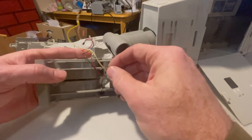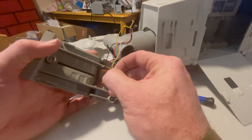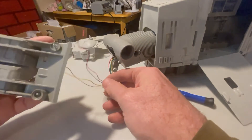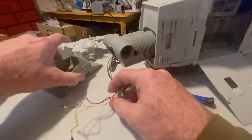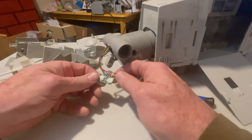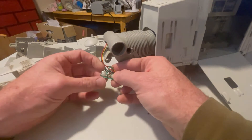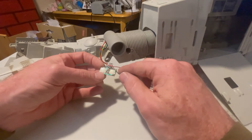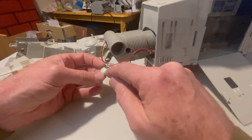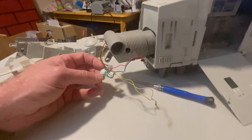We'll take these LEDs out of their clear housings because we're going to wash these as well. We'll just work this circuit board up and through and pull these lights back through. That gives us our seats with the screws off to the side, and now our head is taken apart. Here's a tip: this is what your chin gun mechanisms go up against — you can see how dirty this is. We're just going to hit this with alcohol and a swab to clean it up. You'll find that makes better contact, and you won't have to rack the chin guns so hard.